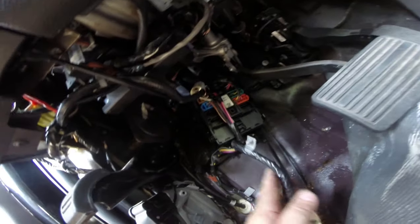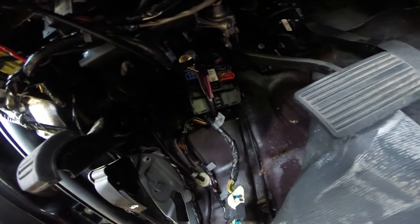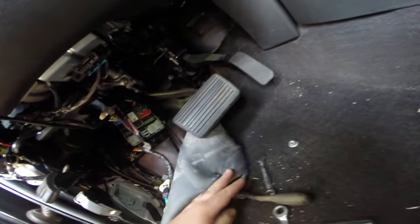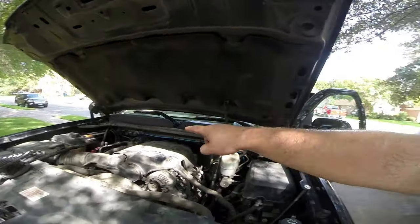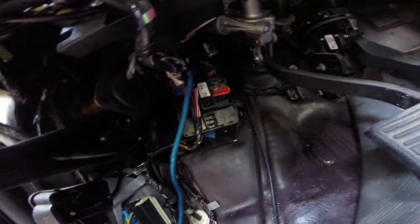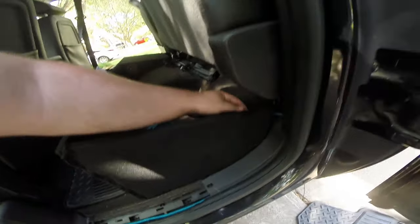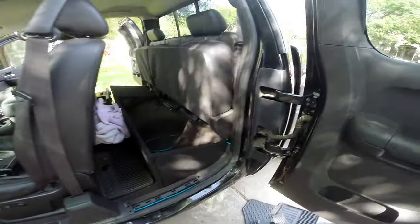There's a panel in here and removing it definitely makes it easier. There's a 14mm nut and a 10mm that goes vertically — just take them off with a ratcheting wrench. You want to make a small surgical incision in that main boot right there. Here's the final path: the battery jumper runs down here through a second smaller grommet I decided to use, comes down under the dash right behind this box. Then it runs along this channel, comes back around to where we're mounting the amplifier inside this wall.